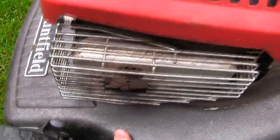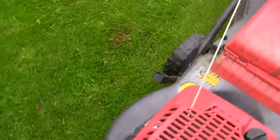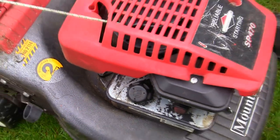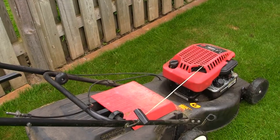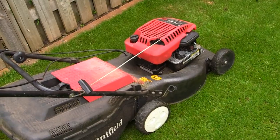You may think, why not tip it the other way with the exhaust facing up? If you do that, you'll have petrol spilling out because the fuel caps on these are vented, and you'll get fuel everywhere making even more of a mess. The only two reasons I ever tip a lawnmower up to work underneath are to change the blade and to wire brush the deck underneath to take the grass off.